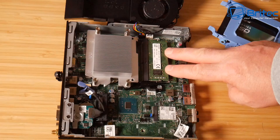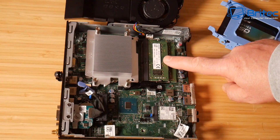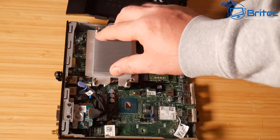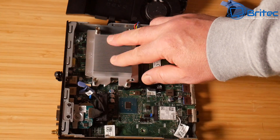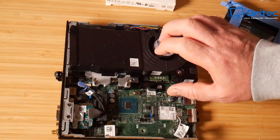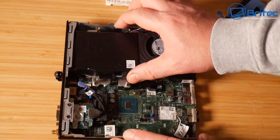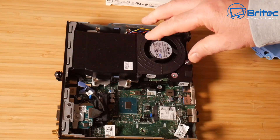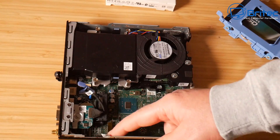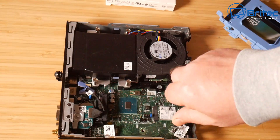I've reviewed quite a lot of mini PCs on my channel — some are expensive, but these can be picked up cheap with different models available, so choose which suits your needs. On this 3050 you've got Intel HD Graphics 630 and an i5-7500T CPU. It might be possible to upgrade to an i7-7700T, but there's not much difference — the i7 has four cores and eight threads versus four cores and four threads on the i5, so check the specs before splashing the cash on a new CPU.